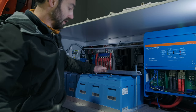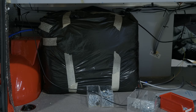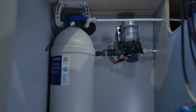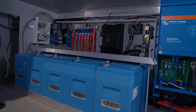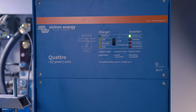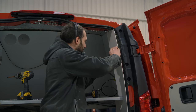When the franchise partner gets a van they have a set round in a city, town or village — mainly business estates or industrial parks — going door to door selling coffee, hot food and sandwiches on a daily basis, constantly using this power throughout the day. A small water tank has been installed to supply the onboard hot and cold tap and the coffee machine via an industrial filter. On the outside of the van, a power inlet socket has been installed and fed to the Quattro via an RCD. During the day the batteries are charged by the buck boost 100 amp DC to DC converter, and when they get home they plug into a 16 amp outlet in charge only mode to keep batteries topped up overnight ready for the morning. A Cerbo GX has been installed to monitor the equipment alongside a GX Touch 50 in the back serving area.